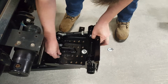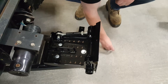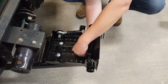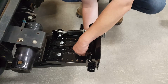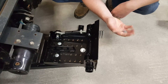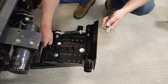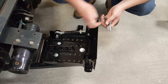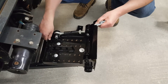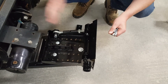Once you've got a location to put your bolts in, go ahead and use the hardware that came with the kit — there's a half-inch nylock nut and washer for the main front bolt, and washers and nylock nuts for the assortment of three-eighths bolts to attach the back of the bracket. Tighten all these bolts firmly. You also want to make sure that the bracket is straight to the front of your UTV so your magnet won't be crooked — we already ensured this when we marked the holes.